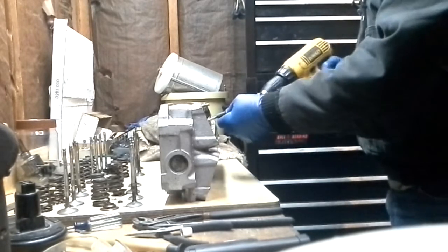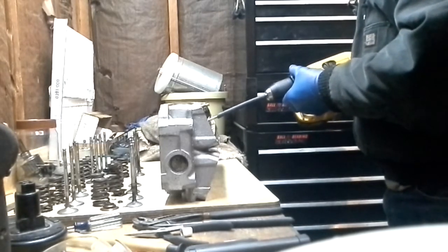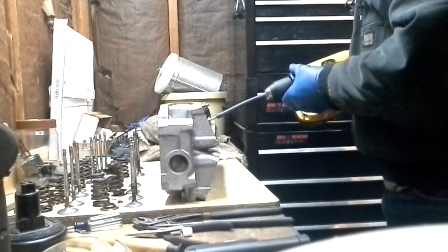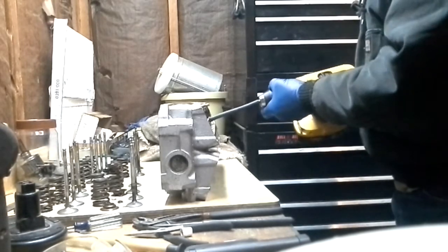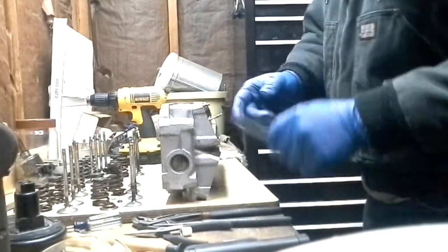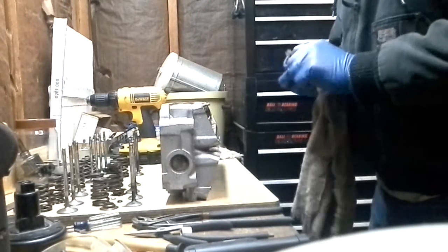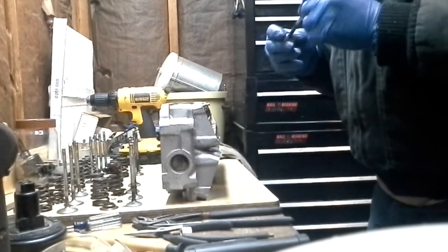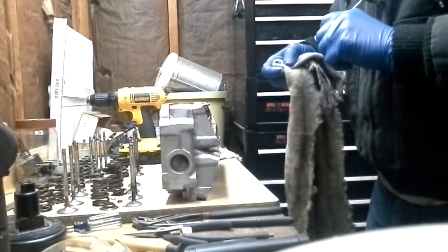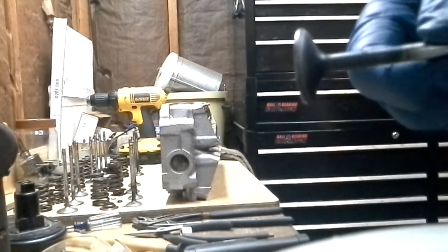You can see I can move this around and there's no pressure on that valve stem at all. Let me just reverse it, pop that off, seat the valve, pull that straight off, pull the valve out, check it, clean it off. That looks pretty decent — it still needs a little bit more, but that's pretty decent.